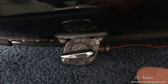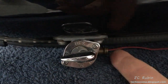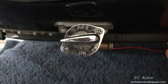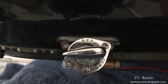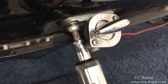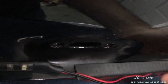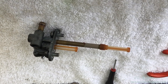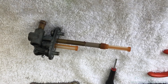Whether working on the tank or off the tank, if you're just replacing the gasket, that's one thing. But you'd actually want to remove the whole entire valve too, especially if you're flushing the whole unit, which would be optimal. Once it's removed from the bike, you'd really want to service the whole thing. The Phillips screwdriver will take this right off. The first benefit is the ability to flush the tank with this removed. The other benefit is the fuel filters for the regular and reserve setting are actually on this device.